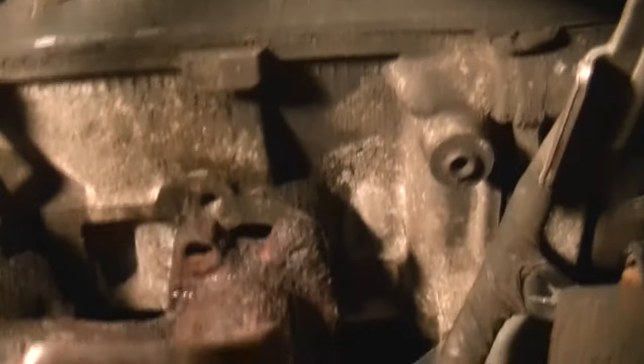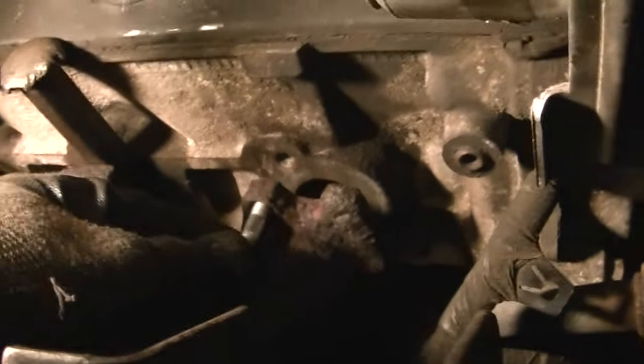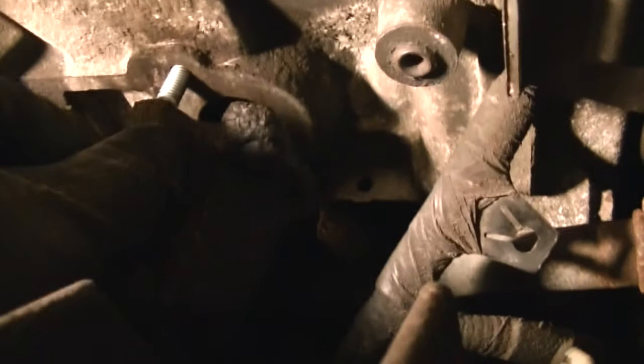I'm going to drop each gasket in one at a time like this, put a stud in there, and just kind of put those in one at a time. I'll start a nut on them, put a bolt on it right about there. I'm going to do them all the way across so I get every one of them in. As I get one of those gaskets started, I'll hand-screw one of these studs in, and that should keep them in place until I get the top row bolts in. Then I'll push the manifold in and start the bolts on the bottom, and hopefully these will go in through the bottom part of this gasket.